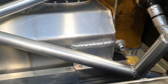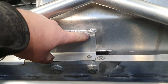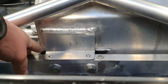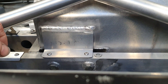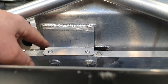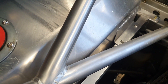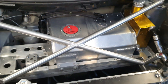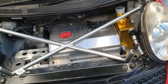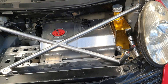I did the mounts - I did explain them in the previous video and then I deleted that. The theory here is we've got a reasonable distance from here up to the wall so that it can have a little bit of movement, a little bit of chassis flex. If we just had this welded straight on to there and then the chassis moves and twists, or you bang into a wall and give it a big hit, it can very easily tear the fuel tank or rip the mounts off. The arrangement I've got here at the moment - it's only got these front four screws on - it can move a little bit. It's just to give it a couple of millimeters of flex without going to the extreme of having rubber mounts.